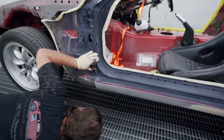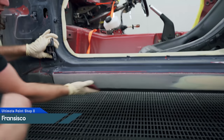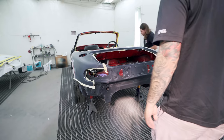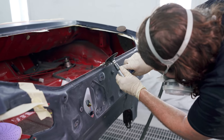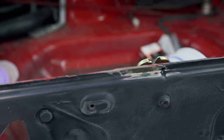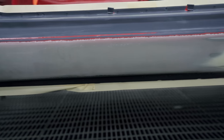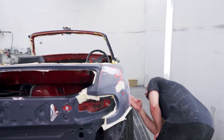Right now I'm just going to scuff down here a little bit, this black, just to make sure it's going to stick with the primer. And then I do have a small rust spot in the back — I'm going to probably grab a grinder and grind it real quick. Then some tape, and I want to remove the wheels so I can prime this repair on both sides.